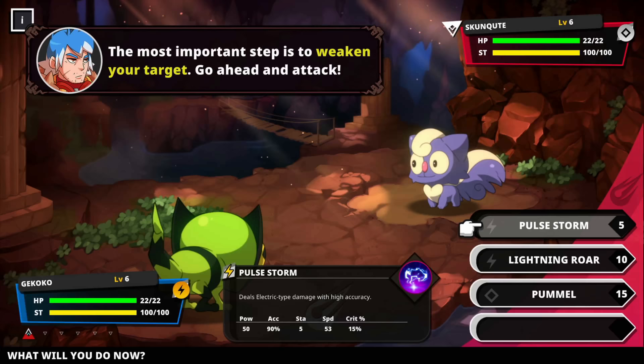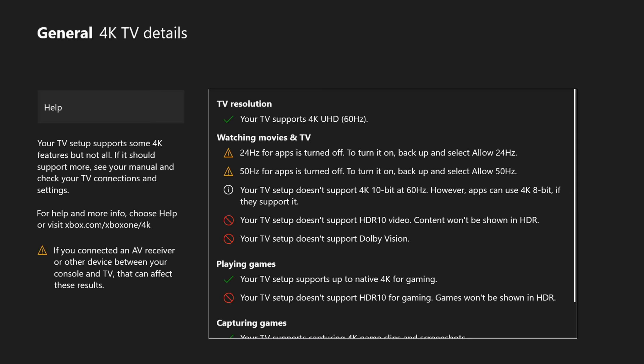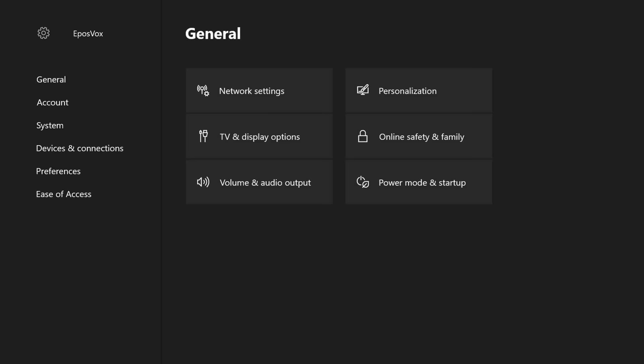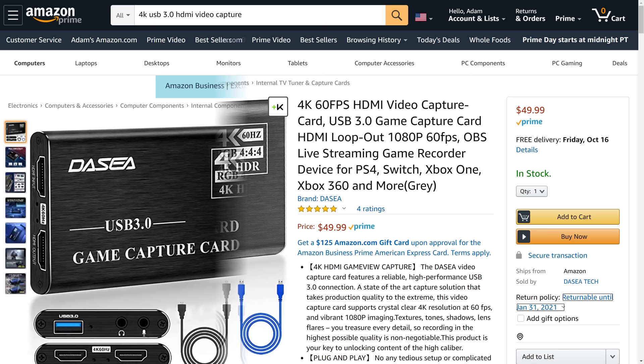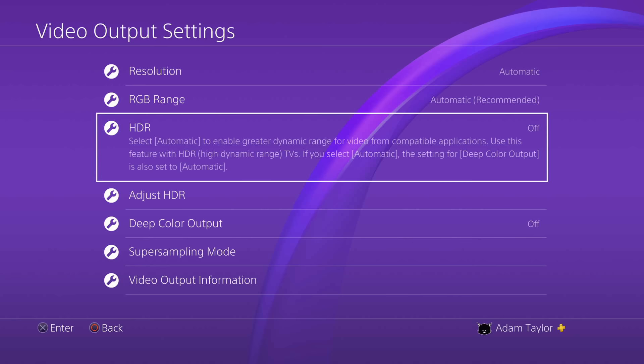It has HDMI 2.0 and HDCP 2.2 input and output for 4K60 pass-through, which is pretty cool — and it does support 4K60 pass-through. SDR only, however. A couple of these models on the Amazon page say HDR somewhere. While I haven't tried those specific models, I can guarantee you with almost 99% certainty that they don't support HDR in any way — no HDR pass-through, no HDR capture, none at all. They're not built for that, the drivers aren't set up for it, and there's no tone mapping software built in.